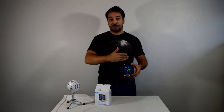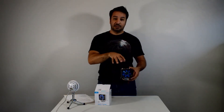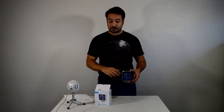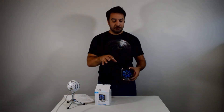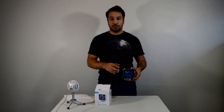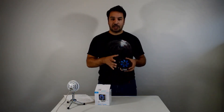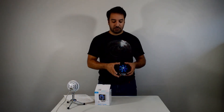So if your case can have a vertical graphics card in it, it'll almost surely fit this tower cooler as well. There are probably only a few mini ITX builds that will not fit this cooler — where the graphics cards have to be laying down. But other than that, it's actually a tower cooler that stands pretty short.